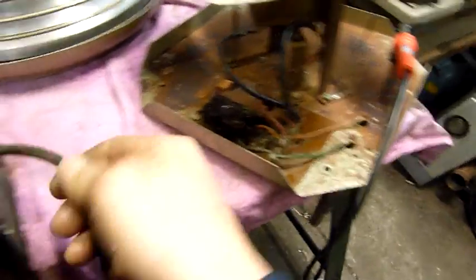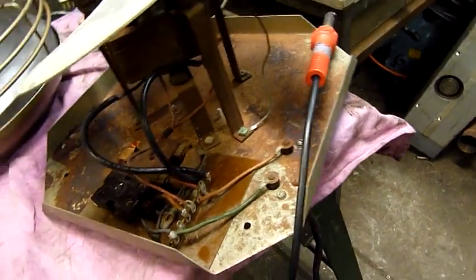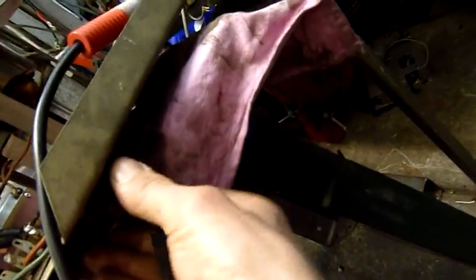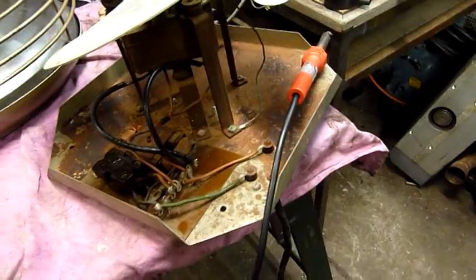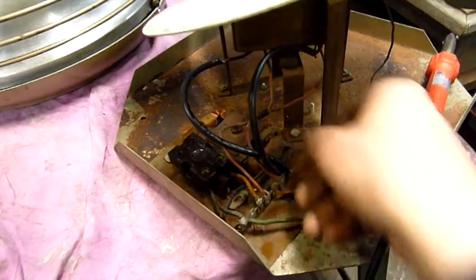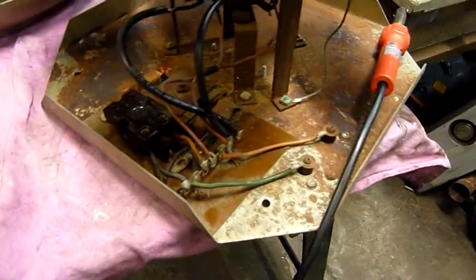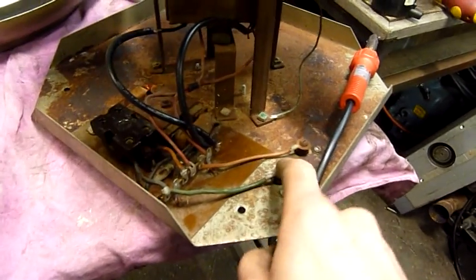It has started going to ground, and it's probably due to all this old rubber flex. I took out the RCD last time I tested it, so I'm going to bypass this old terminal block, which is pretty much completely unnecessary since you don't see it. I'll just keep the old switch and all this stuff here. I'll just make sure the wiring's pretty sturdy and safe. That's all pretty good material there that's insulated, but I've got a feeling the problem's in there.